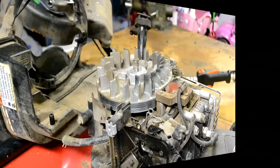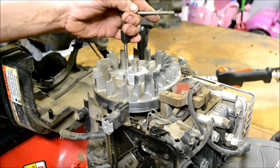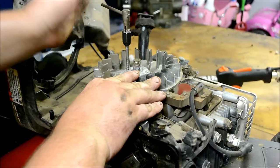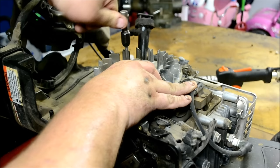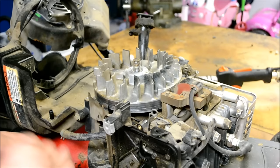To get this flywheel off, you may have a different method than I use. What I like to do is tap the two holes that are here in the flywheel with a quarter-20 tap. You don't have to be super precise, but you do want to get it halfway straight. This taps the holes for your flywheel puller. The Briggs and Stratton flywheel puller screws are self-tapping, but I still like to run a tap down in here just in case it might catch a thread and split the flywheel.